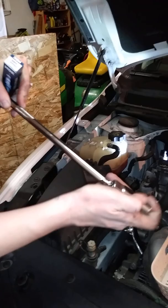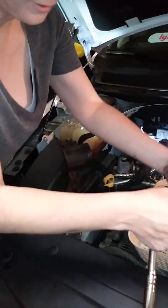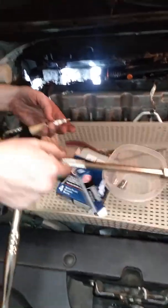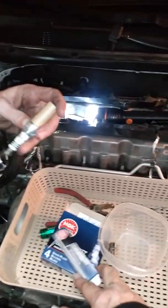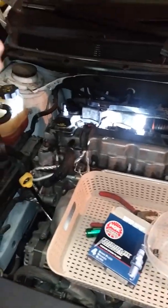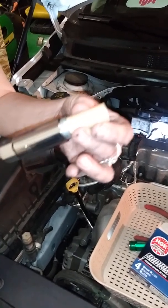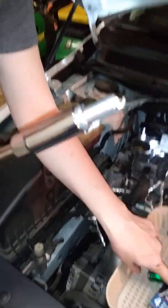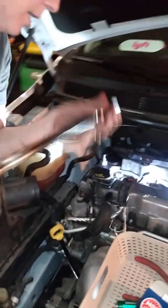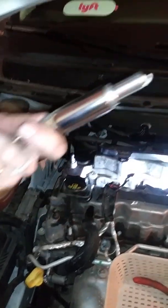So I'll show you — I'm going to attach my spark plug puller. Then we take the spark plug. I'm doing it over this basket just to make sure I don't drop anything. What you want to do is keep that cardboard on and put this over this until you get it to fit, then take the cardboard off. These are pre-gapped — that's why I like the NGK. I don't have to do any gapping. They're already gapped and they look beautiful. Let me pull one of the old ones out real quick so I can show you the difference.